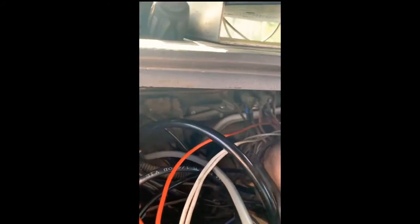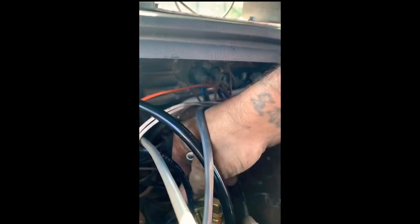to your control port on your trailer valve. And then this delivery port on your trailer valve will go down to your tractor protection valve. That's 3/8. Delivery from the trailer valve. Luckily, I found a port up in here to the firewall. Not to drill any holes. I just ran it behind this wiper linkage right here. That'll break it. And hook it right into our supply or our delivery port. I need two hands.